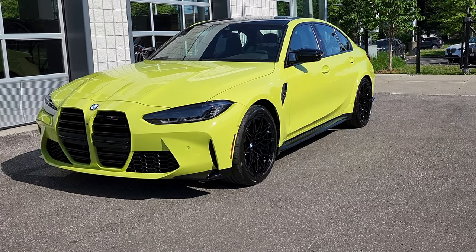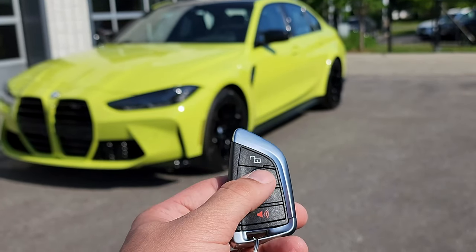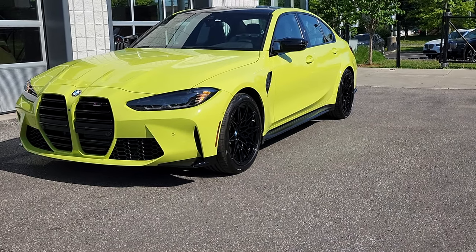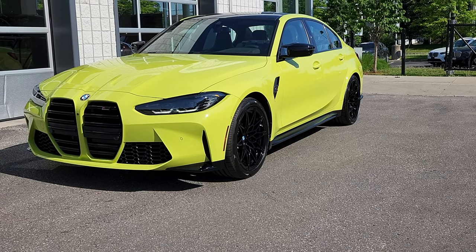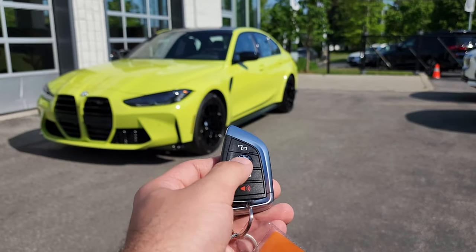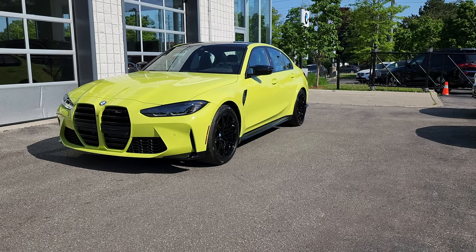Now to turn on the BMW, from the key fob click three times on the lock button. The lights will flash for confirmation — engine started. The engine will run for about 15 minutes and then turn off if you don't go to your vehicle. You can also turn off the remote engine start by clicking again three times on your key fob. Lights will flash for confirmation.